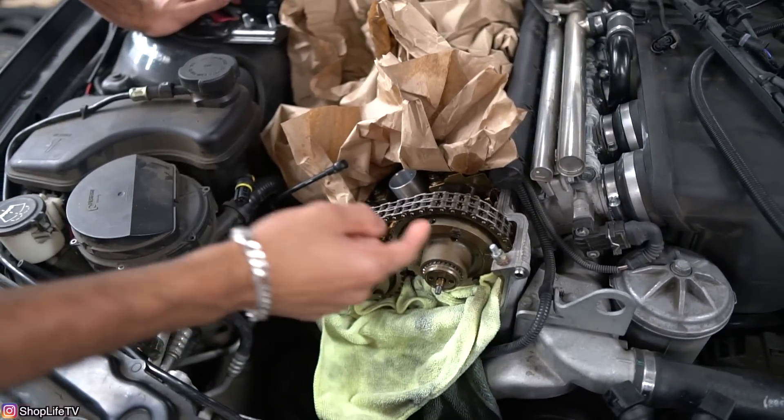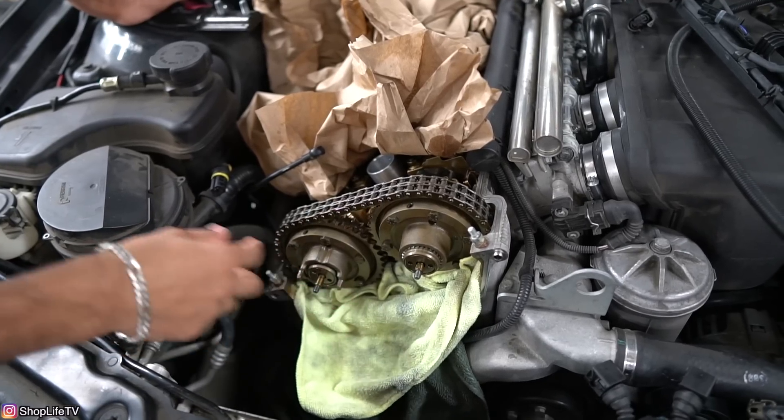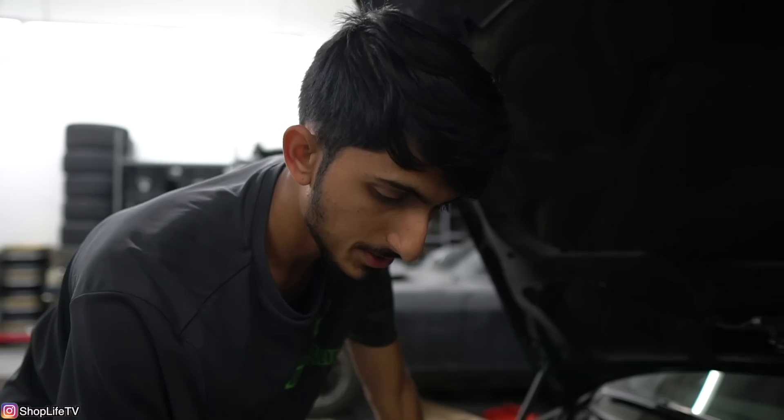As with the bolts, there are upgraded items for the intake cam bolts. There's also an upgraded hub available. VAC Motorsports just came out with one and they have beefier tabs — it just fills up that oil pump disc a little bit more. There's also the Turbotoy hub, which is practically the same thing with enlarged tabs. Then there's Dr. Vanos — they have cryo-treated hubs with some special metal treating, making the hubs and tabs a little bit stronger, and they also have a beefed-up hub with beefier tabs. There are quite a few options, and preventatively there are so many measures you can take so you don't have major issues down the road.